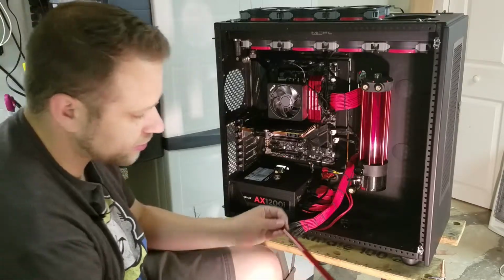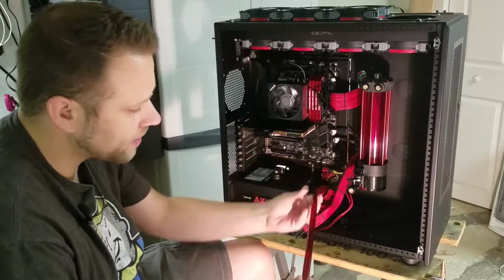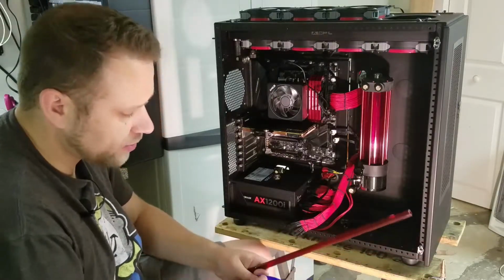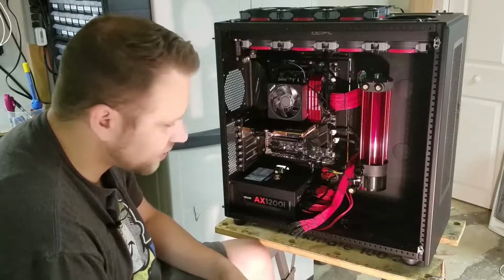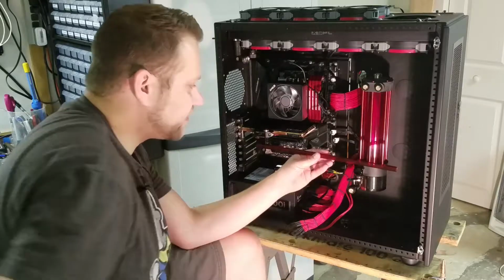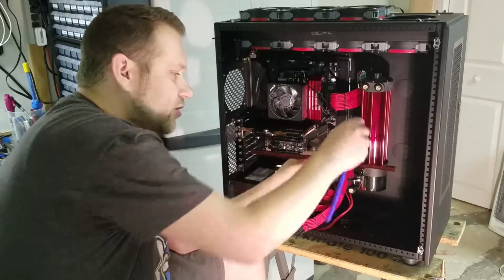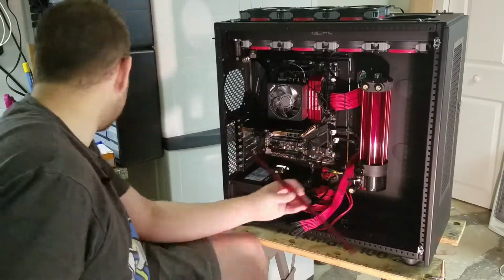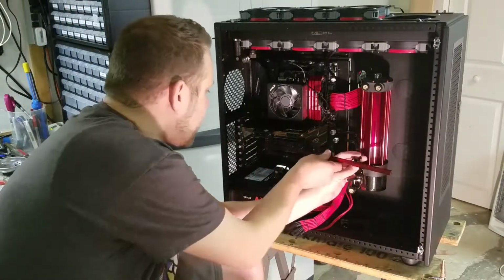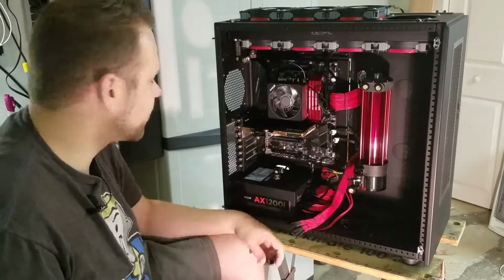If you took this tubing and put it over the top of a heat gun and went to bend it, the hollow here would collapse on itself, but not when you've got the silicone insert. But still, that's a lot of heat in one area. So what we'll have to do is measure this out, achieve this 90, let the plastic cool, and then focus heat on another section over here and try to get a 90 going back down. It would be convenient if I could just add another bracket here, but things being as they are, I don't think those measurements are going to be possible.